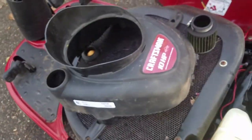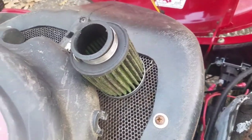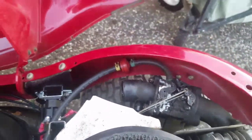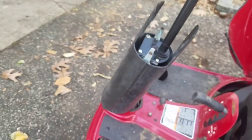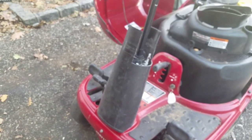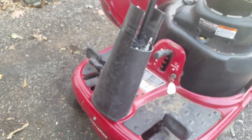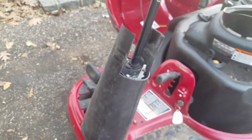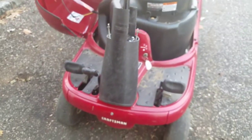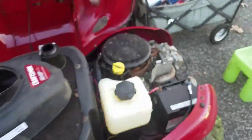I'm thinking it's the carburetor and it just needs to be cleaned. I've already removed the top cowling, the engine cover, and this air filter — which I don't think is stock. It looks like one of those K&N things. And I fabricated a steering wheel column cover from an old leaf blower tube just to cover up most of the column — obviously a makeshift fix, looks okay, not great, but better than nothing.